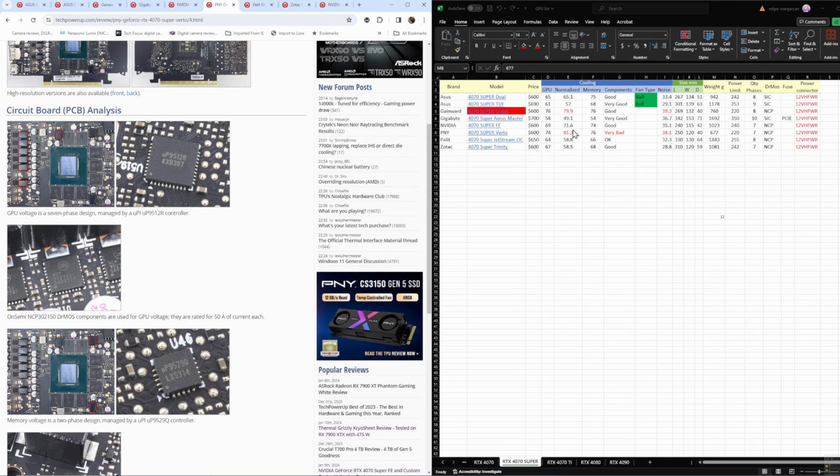So it doesn't have a direct contact. The temperatures are similar to the Gigabyte. The noise is also similar. And again, $600. No headroom in the power limit. Just 7 phases. There is no point in this card again. I also would say skip this one too. So these two you can skip. The rest, depending on the availability in your country, you can consider, and also the prices.